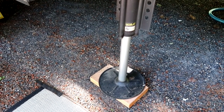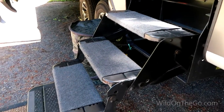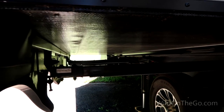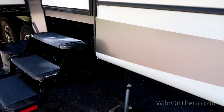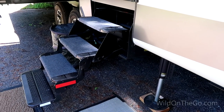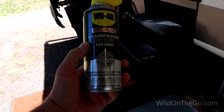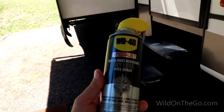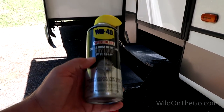There are several movable parts on the outside of an RV — for example, stabilizer levelers, the hinges and joints on the steps, hinges on the door, locks, and on our four slides we have two gear bars on each one. All of these require lubricant to function well, and since they're outside they collect dirt and dust. So I use a dry lubricant, which is said to be dirt and dust resistant. Any type you can find should do the job — you can also use it on bikes, strollers, and other things. Dry lubricant is the way to go for outside use.